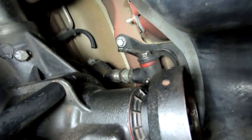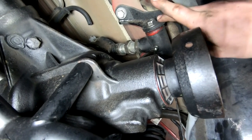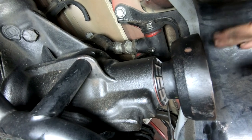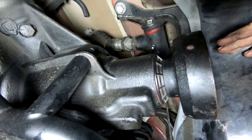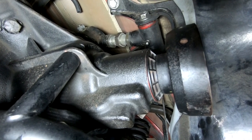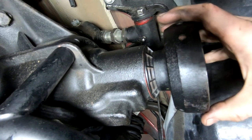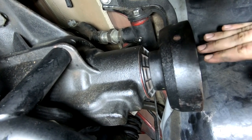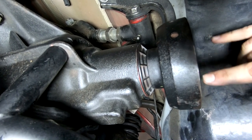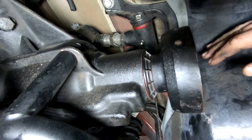So anyway, I've been trying to figure out what the deal is with these positions on the upper bolt or bottom bolt, and what it comes down to is anti-squat, which is very cool because I didn't know I had any adjustability here. But most aggressive setting, which actually explains why my axle is hopping up and down so violently without having the shocks fully tightened. Fully aggressive is where it's at right now. So the most anti-squat you can have means the car is really trying to fight any kind of squat. It almost goes to the point of where it starts putting in positive separation at the track. So higher horsepower, more anti-squat you want, basically, is what it comes down to.